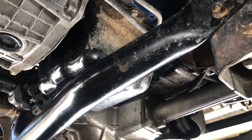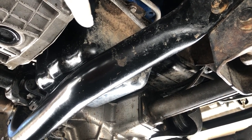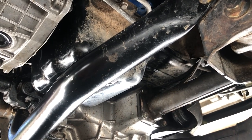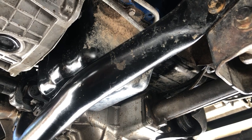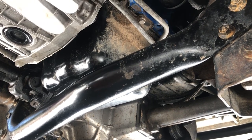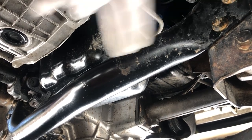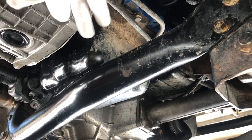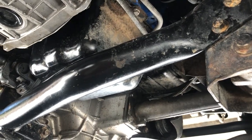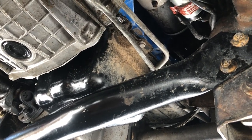I wanted to start by showing you how we got our pan off of the motor and out of here so we could get the gasket changed while the motor is still in the truck. In the case of our next video we have the engine out, so we'll be able to show you all the details. Both of our service manuals call for hooking up a cross support up top and raising the motor — you'd have to take out the motor mount bolts on the sides and raise the motor two inches. Well, nobody really has that cross support bracket or they don't want to hook up an engine hoist.